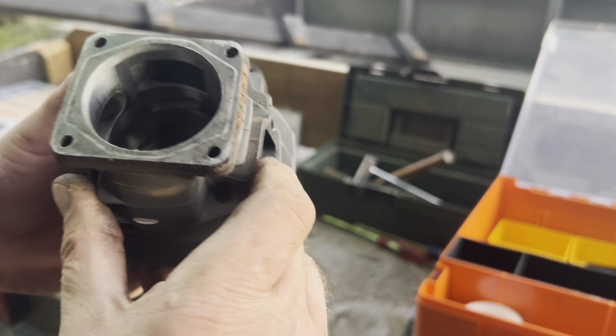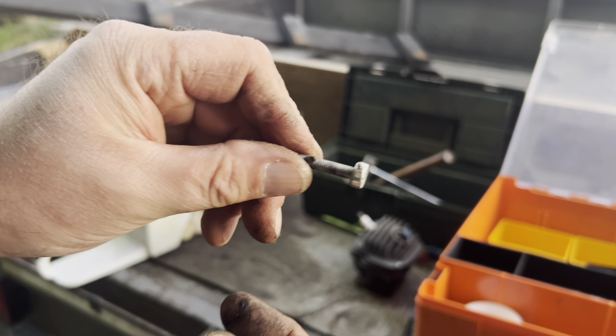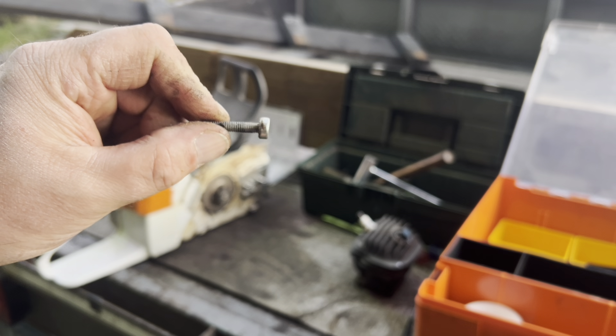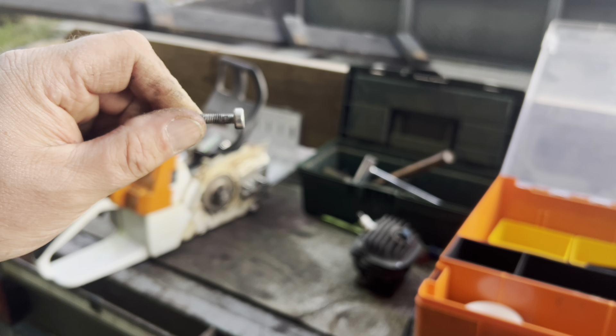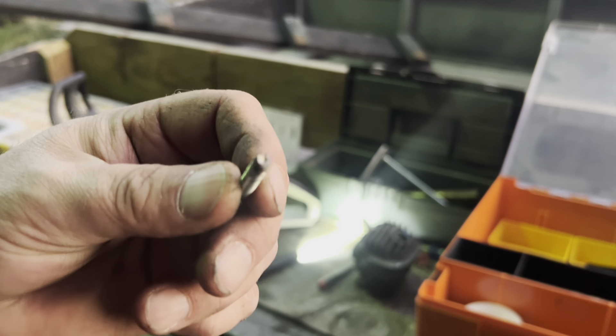Extremely lucky — that's absolutely crazy. I've got two head bolts left and they're both bent, and you saw I just found the head of one of them. This is the end of the stud right here where the Torx socket would be, and it broke right off the top. That's the bottom of the Torx hole right at the top of the screw — very, very thin wall.